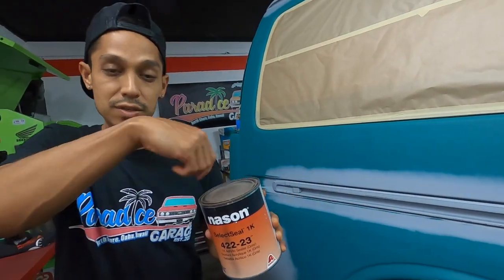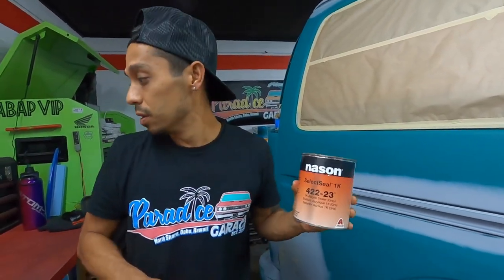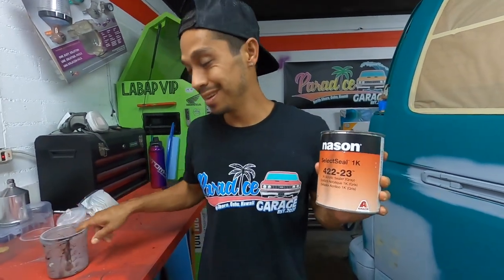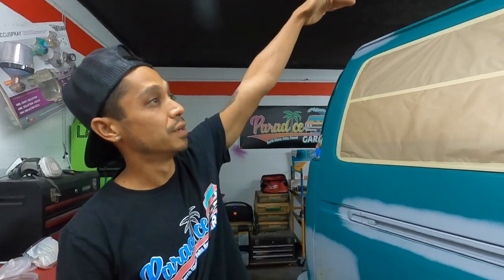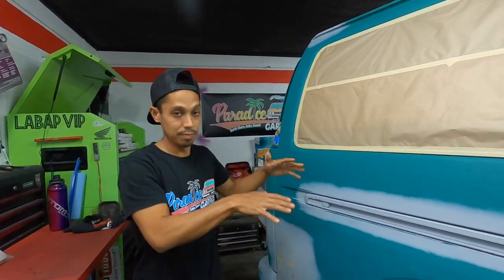All we do is just mix it in here. We don't add anything to it. Put it in our gun, spray it. And then about 15 minutes, 20 minutes after this dries, flashes, then you spray your paint. But we're not gonna worry about it because we're gonna start on the roof and then come down. Pretty much it. See you in the next clip.